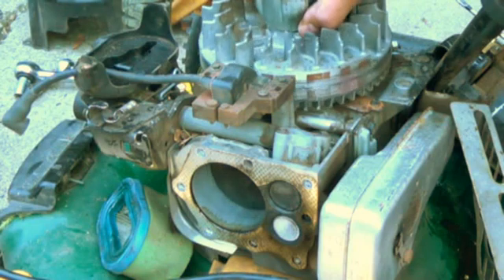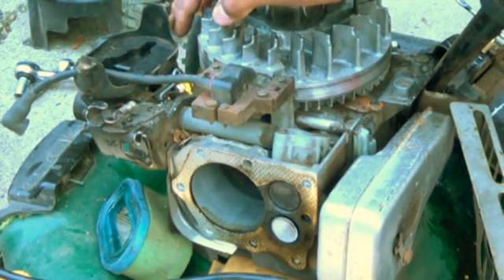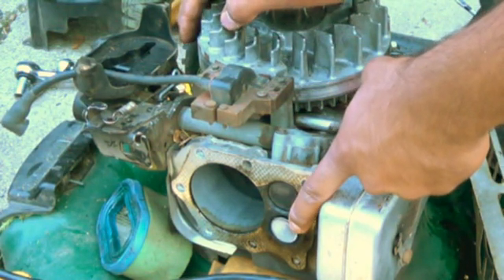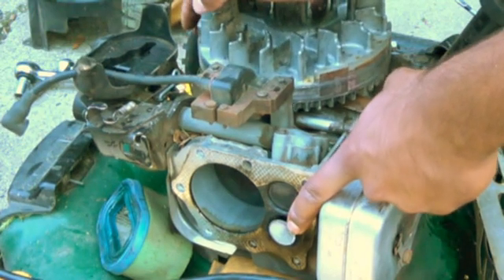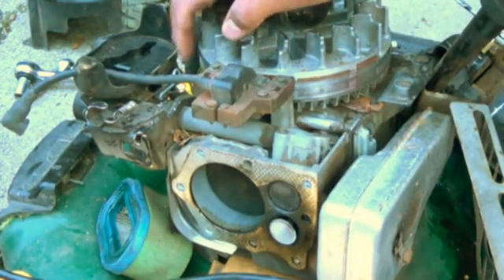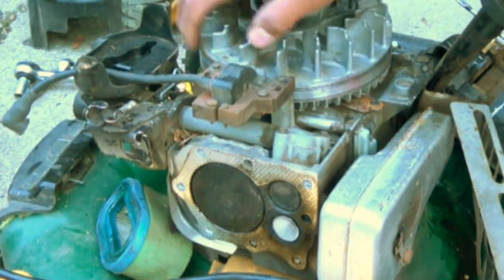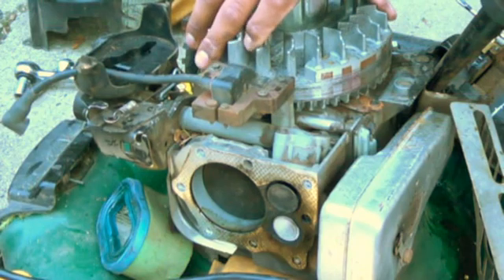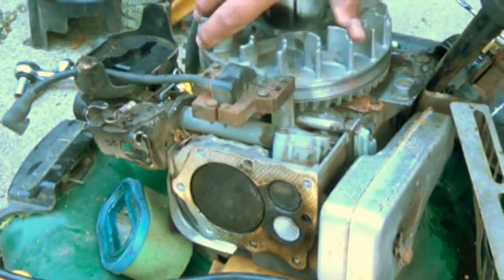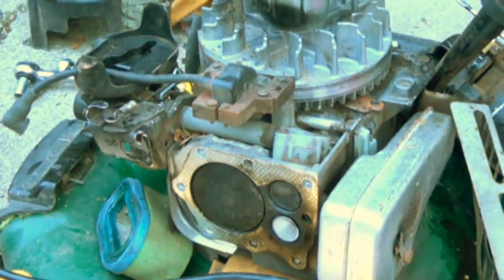It's pushed down, work is done, and then once it reaches rock bottom again it starts making its way back up. But this time it's the exhaust valve that opens and the combusted gas is pushed out of the motor, and then the cycle restarts back at the top. So: the piston fills with gas, compresses, ignites, exhaust — that's pretty much how a four-stroke motor works.